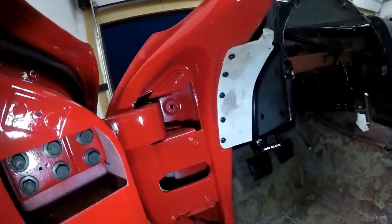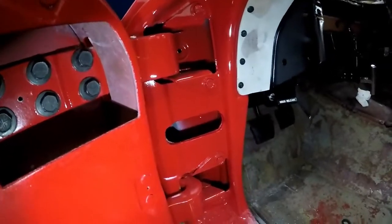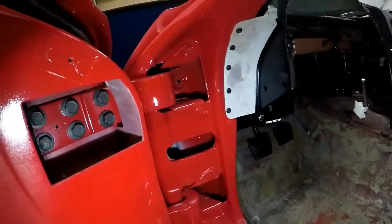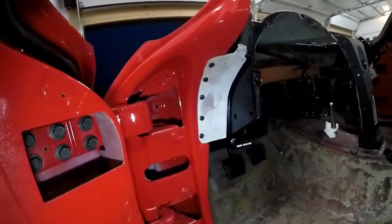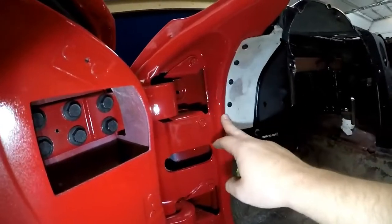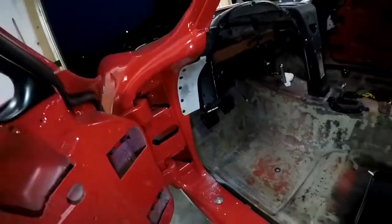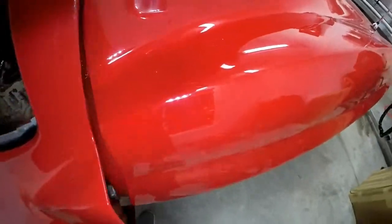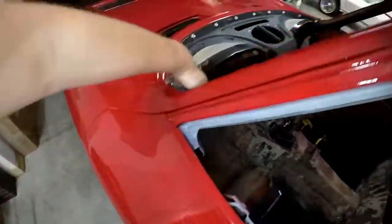That's a wrap on installing the dash. All I have to do is tighten up these bolts and clean up my mess. You've got all the rivets. Now if you took the dash out of your car to recover, paint, or restore something, you won't have to re-drill all these holes. But since the car was stripped at one point, the original dash is long gone, so we bought this 63 dash. The holes didn't line up 100%, so I filled the holes in the body and did a couple of repairs on the dash and had to drill fresh holes. Now I can actually get the doors to latch — before I couldn't close them so I wouldn't rip these little tongues off.